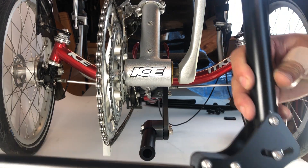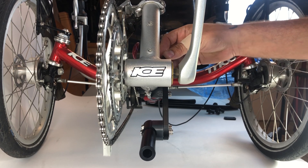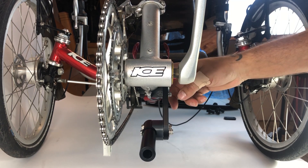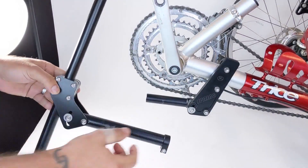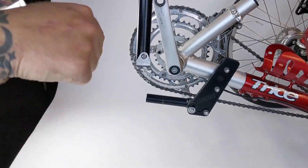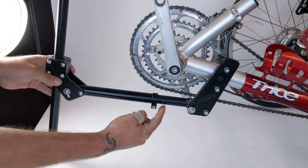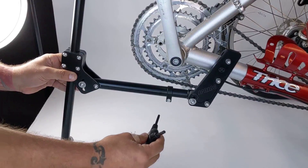Before we attach the mounting block assembly to the bow tie assembly, we want to make sure that the bow tie assembly is nice and plumb. This is an instance where having a friend to help out can be really handy — they can stand in front of the trike while you sit in the seat, and then line this post up with the derailleur mast, the main tube of the trike, or the straightness of the chain rings. Now it's time to install the mounting block assembly to the bow tie assembly. Make sure the T-clamp is facing up, the stainless pieces are facing down, and the bolt head on the collar clamp is facing the non-drive side. Make sure the one-inch tube slides over the 7/8ths tube at the minimum point or less, then line it up and tighten down the bolt.